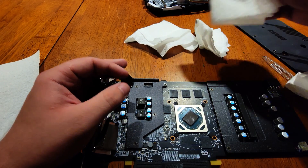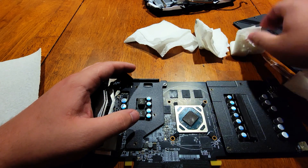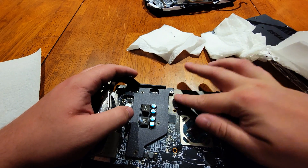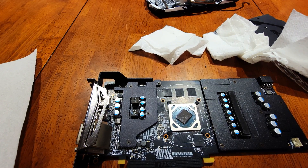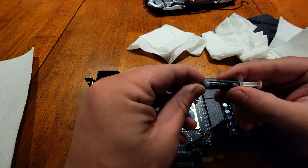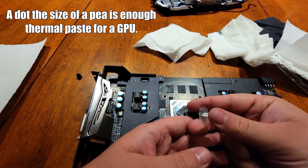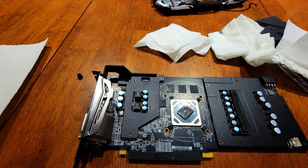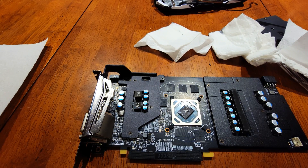Now that we've got everything cleared out, take a rag and dry off any excess alcohol. We've got a little bit of old compound on the chip — just want to make it nice and clean again. Now we use our thermal compound. I got some from Cooler Master — it's the Master Gel Pro. It came with the cooler I'm going to use, and it's more than enough for a CPU as well as a GPU. That should be plenty right there. This compound is non-conductive, as per Cooler Master's website.